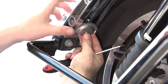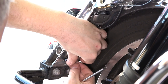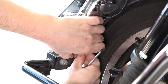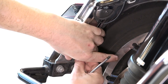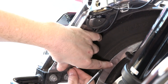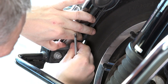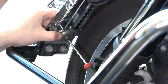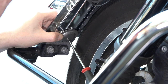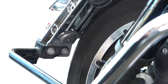Working on the bottom now: the top metal plate's semi-circle faces down, while the bottom one faces up. You can see how they're concaved — the concaved portion protrudes out. You can put those brackets in backwards so make sure you don't do that. Just tighten snug plus another quarter turn — do not strip the plastic out. We're doing this to both tail lights on both sides of the bike.